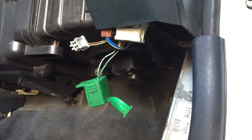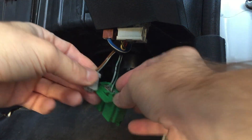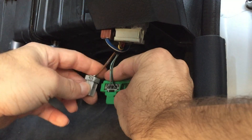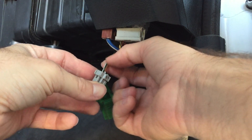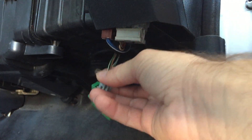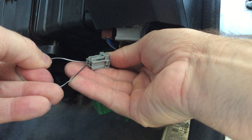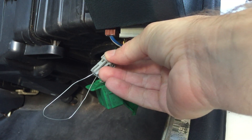I didn't know about this, so I want to thank my friend Juan, who you saw in other episodes, for telling me about it — and his friend Dusan for explaining it to him over the phone. At the service port, the plug you need is the one with the brown and green and white striped wire. There are two plugs; one has a blue and green/white striped wire, but we're working with the brown and green/white striped wire. You take your paper clip and literally short the circuit out by plugging it into the two holes.